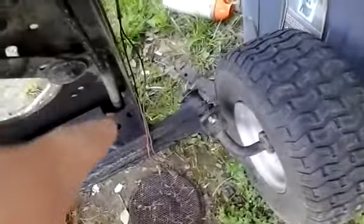It's a piece of flat iron going from that bolt. That bolt's welded to the frame itself and runs across to that cotter, that hitch pin right there. And that shaft, the pole, will go all the way to the bottom on the clutch right there. That is for the brake. That's for the clutch. And I got to flatten the bead. I got to drill and put the spring right there, and probably put it in the side up there.